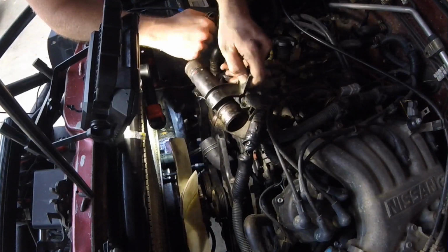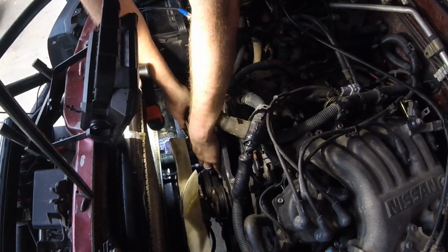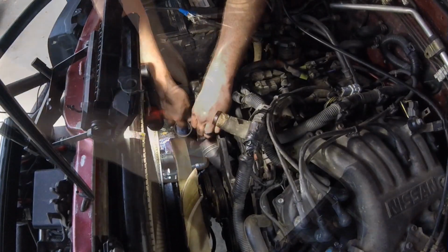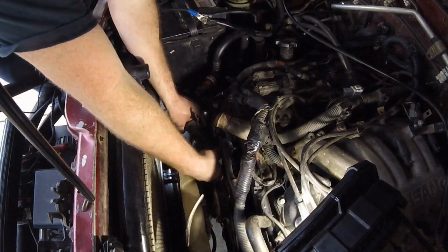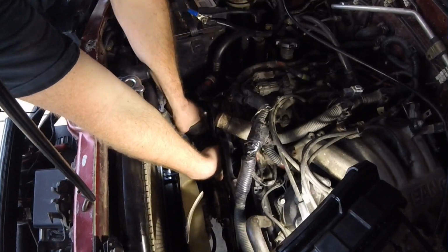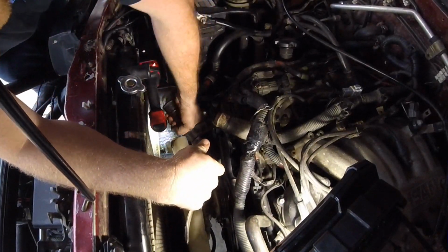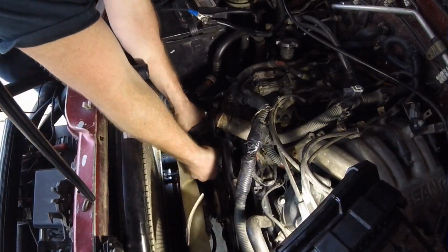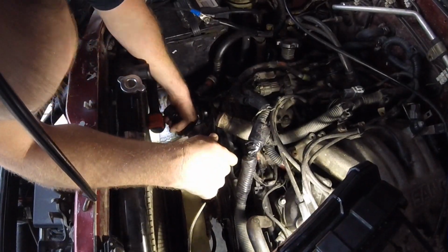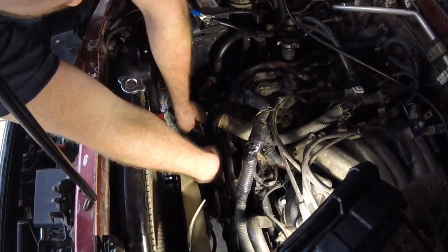So this is that metal tube that connects the 2 hoses together, so I'm going to go ahead and loosely get that into place and get the hose clamps loosely aligned. So these OEM hoses are definitely a tighter fit, and definitely a little bit more difficult to assemble than the aftermarket hoses that I had previously used. So, you know, maybe that's why they leak. Easier to assemble for a do-it-yourselfer, but maybe they don't seal as good. At least they did not in my experience. Maybe it was technique on my part, who knows.